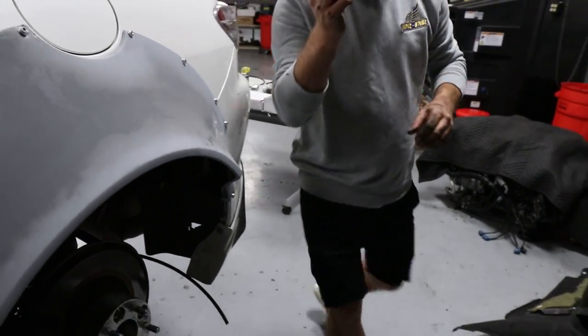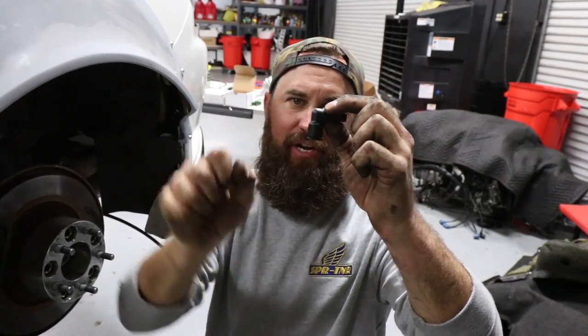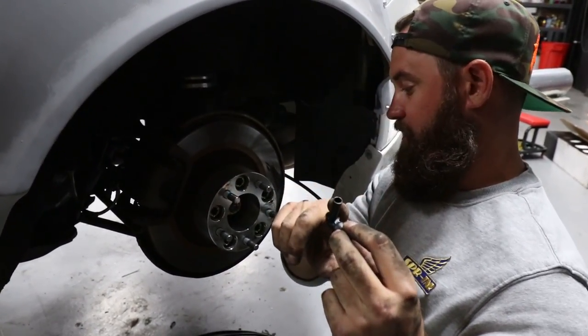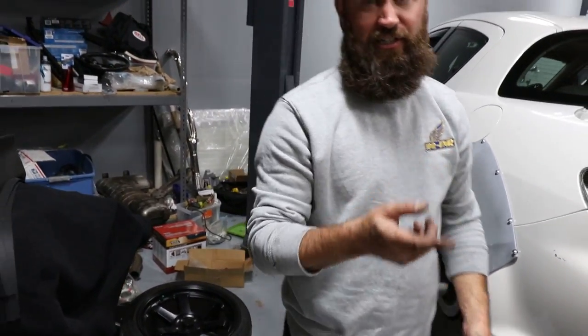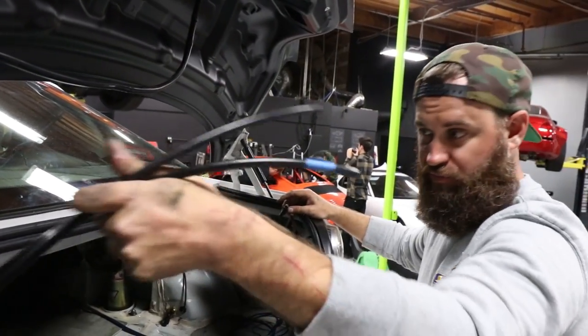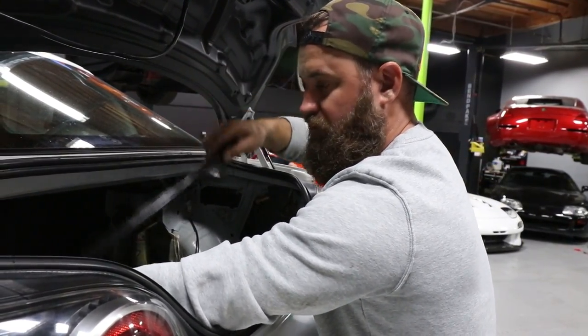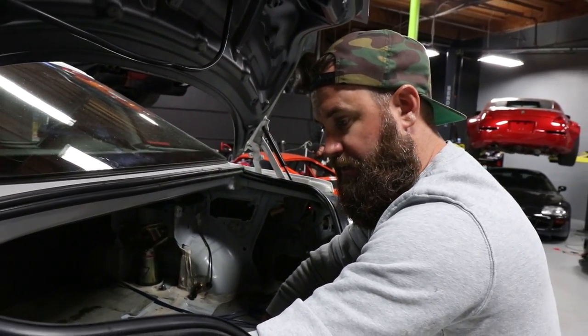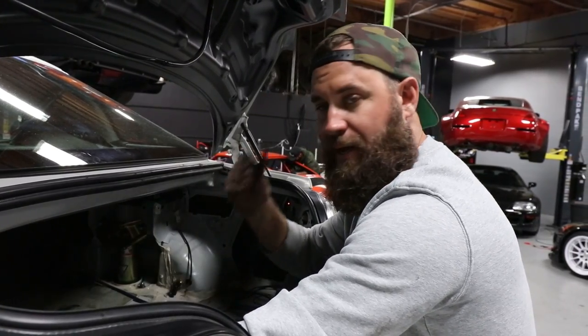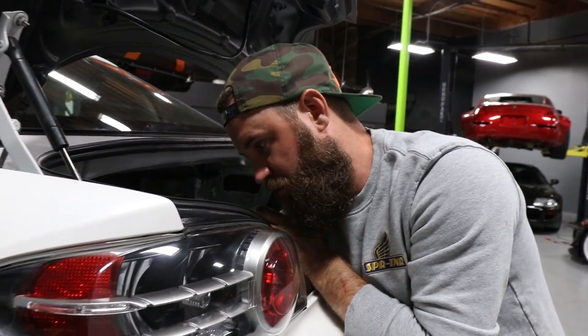Nice square cut. AccuAir provided these 90-degree fittings — they press into the bulkhead and your airline goes in, giving you a 90-degree bend instead of putting tension on the hose directly into the fitting, which will eventually leak. The strut is connected to the bulkhead. Now all we have to do is run the airlines from the bulkheads to the endo VT tank. Since these are our front lines, we'll run these to the driver's side of the tank, cutting about a foot or foot-and-a-half off. These 90-degree fittings really help get the hoses out of the bulkheads in a clean fashion.